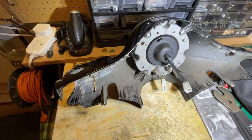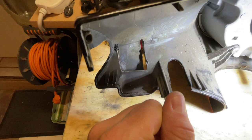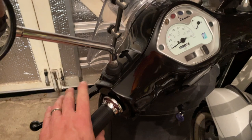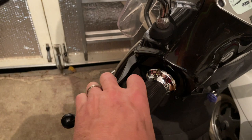To tackle the brake lever problem, I've taken the handlebar cover off once again. I can see quite clearly this is the problem - this little notch here is where the brake handle is rubbing as I pull it. So I'm going to try to grind away at that and see if I can make that fit thinner. Hopefully that will solve the problem. We've got the handlebar cover back on, windshield, mirrors, everything. The grinding and filing I did on the cover worked because now the brake lever springs back like it should. I don't have to push it back with my hand anymore.